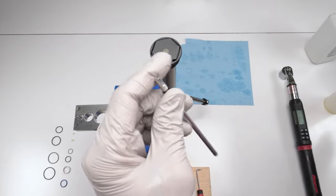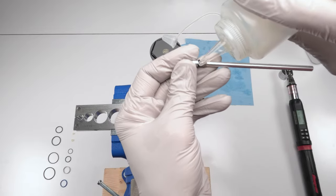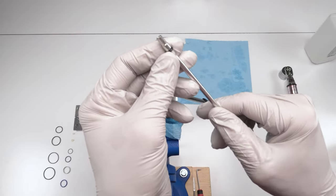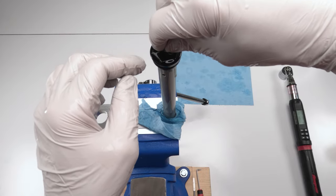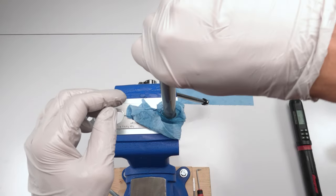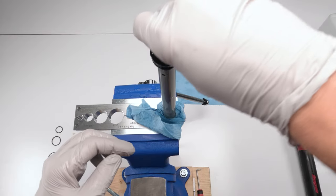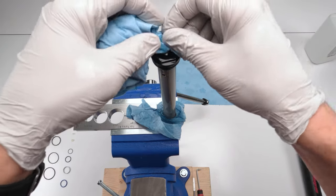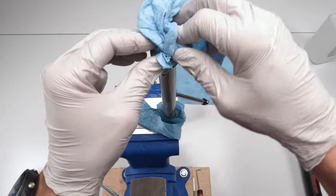And before we torque down the top cap, we take our compression needle, put a little bit of oil on it, right? Just lube the needle. More importantly, lube the O-ring. Then we're going to slide it in. This is literally a bleed hole right now. Right, and then we're going to turn this 3 to 4 full turns. There we go, and it is locked in there. Let's try and absorb whatever oil on the top over here that came out. Like I said, these are pretty easy to bleed.